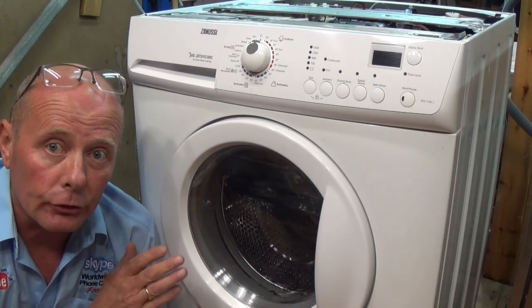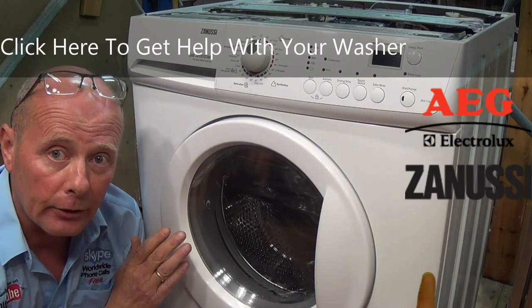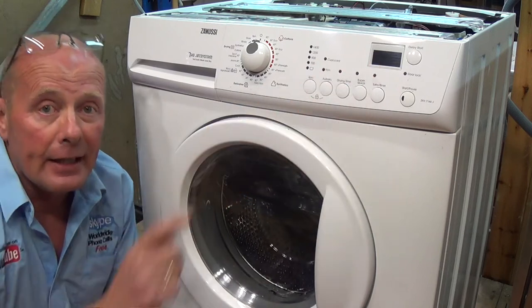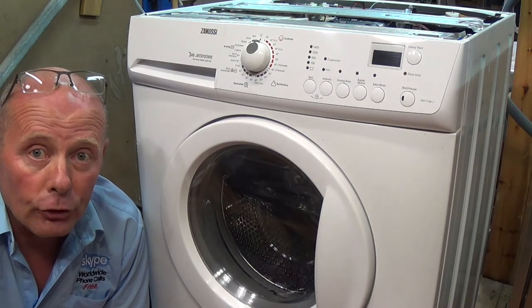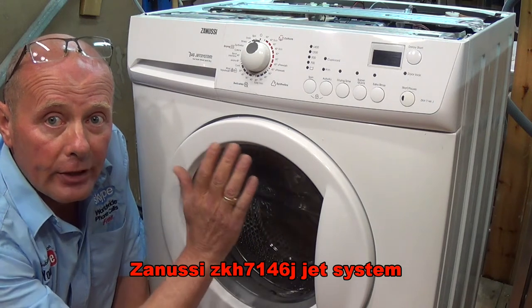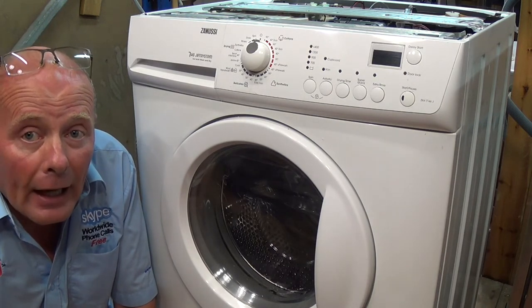We're going to enter diagnostic mode now. There are a couple of important factors: firstly make sure the drum is completely empty with nothing in the machine. Always be next to the machine during diagnostic mode because there are features where the water level will go all the way up to the soap drawer on positions one, two, and three. If you have an LCD display the machine will show different water levels and air temperatures as it rises. This diagnostic system is only confirmed on this specific model — do be cautious, and remember this work should be done by a qualified technician.